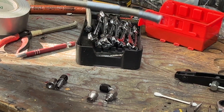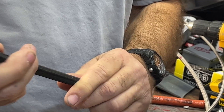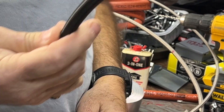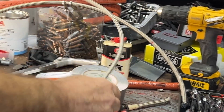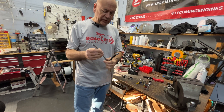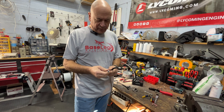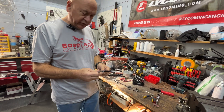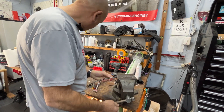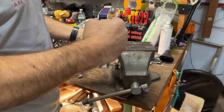Let's look at what we need to do to actually make this happen. We'll start with the easiest hose first — just your stock braided hose. In this case we're going to use this as a fuel line overflow. We've cut it to length, and I'll show you how. What you want to do is have a handy roll of duct tape. Mark where you want to cut it, wrap some duct tape tightly around there, put it in a vise — don't clamp it real tight — and get a hacksaw. I like using a hacksaw with 32 teeth per inch; it makes nice fine cuts.